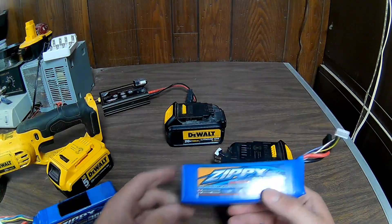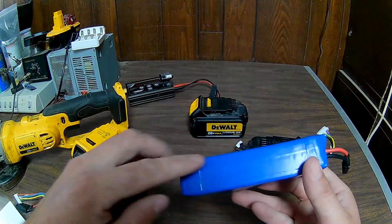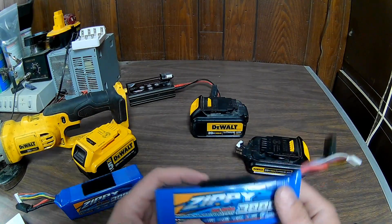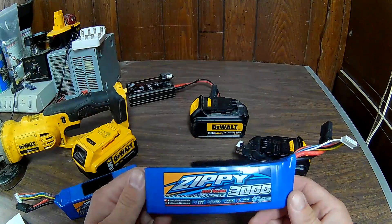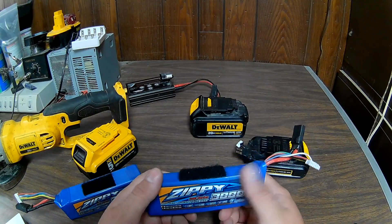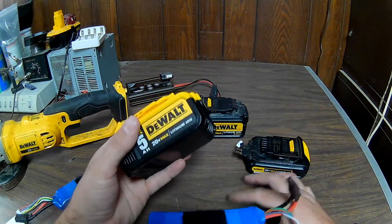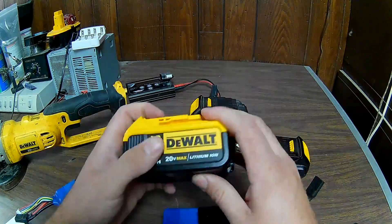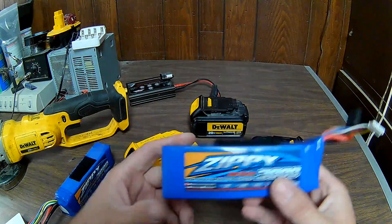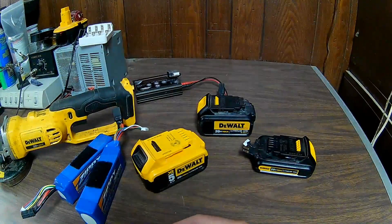You may be asking why manufacturers don't use these LiPo packs. As you can see, they're a five-cell soft pack, not round cells like the 18650s in the other packs. The reason they probably don't is because these are kind of like a grenade — if you fully charge one and hit it with a hammer or puncture it, it could be a huge fireball. You can get them in a hard plastic case which helps a lot with protection, but you still need to be careful.